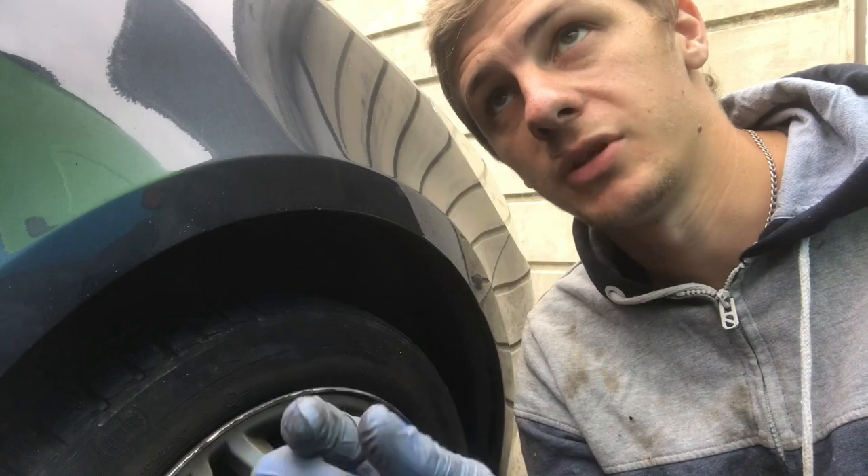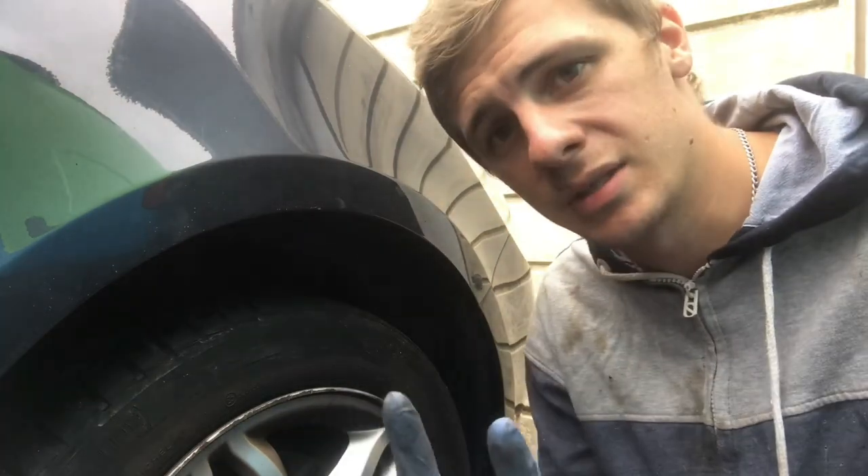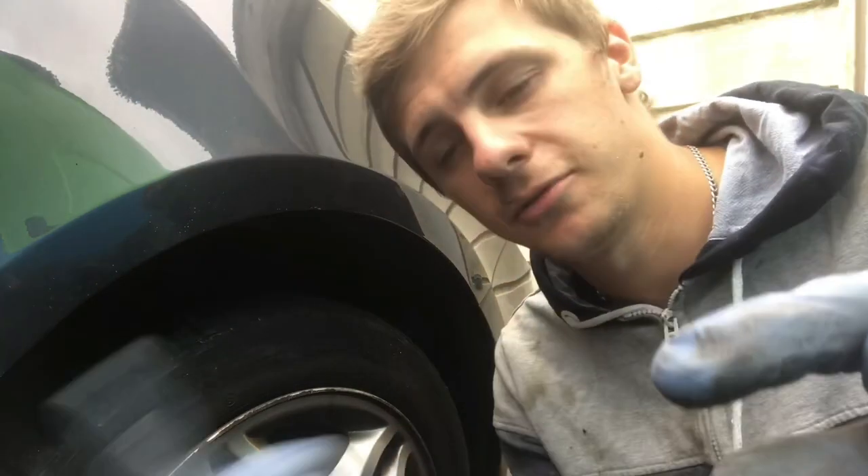For brakes, you're looking for decent thickness on your brake pads and discs — it is set out on the disc itself what the minimum thickness should be. You can measure it with a special gauge, or you can use two known flat bits of metal — even two bottle caps — to pack it out from the lip of the disc, get a pair of calipers over it, find the thickness, subtract your packing, and that tells you your brake disc thickness. Compare it to what it says on the disc. Make sure your pads have got life left in them — this car may get an advisory on the pads but should have a thousand or two miles left.